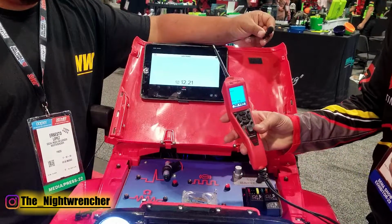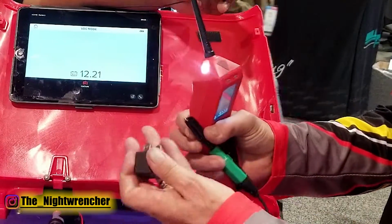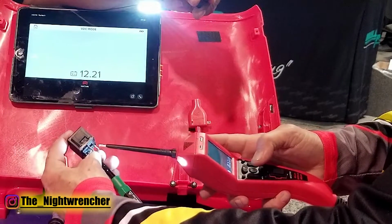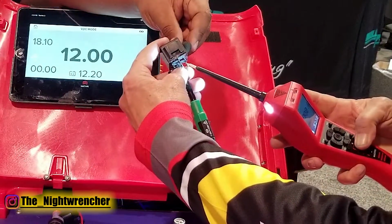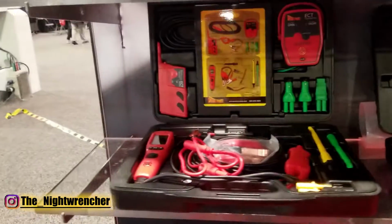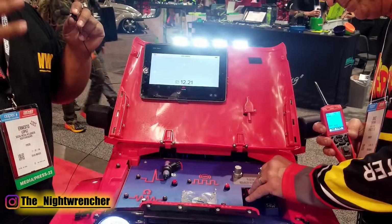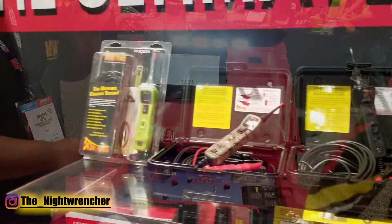Last thing I need to check is the relay itself. We've got a little ground lead. I can put on one side of the energizing coil. We'll power up the other side. Should hear the relay click. So real quickly, because you can activate the components themselves, I've tested every aspect of that circuit, including the relay itself. So traditionally, we would probably use something a little bit more old school, like a digital multimeter.